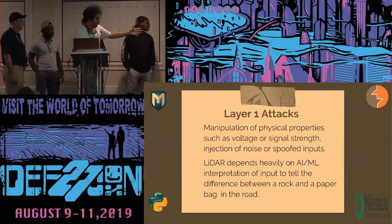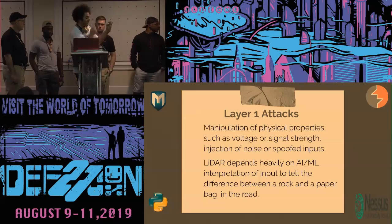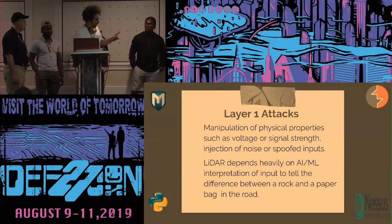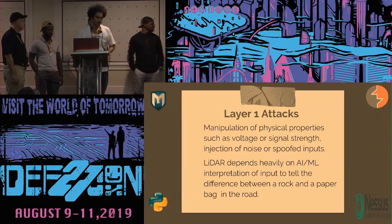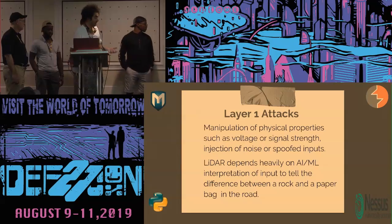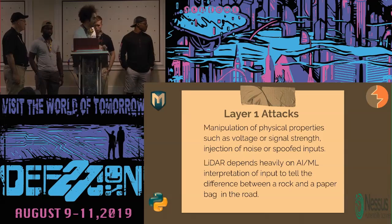The sensor used in these cars is a 904 nanometer infrared sensor where even the smallest speck would be picked up. So if we had something that could create a cloud thick enough, it would register as a wall. As you could see on the previous slides, a human is even less dense than the cloud itself, so it could detect the cloud as something even more solid than a human or a baby carriage. That makes it a potentially dangerous thing.